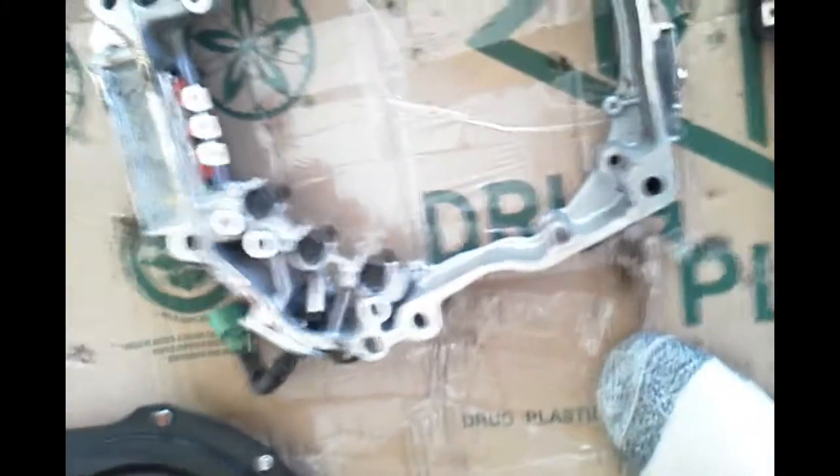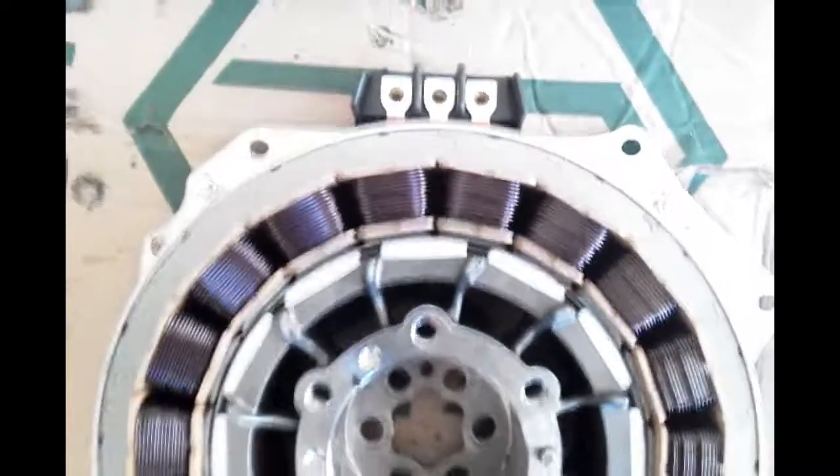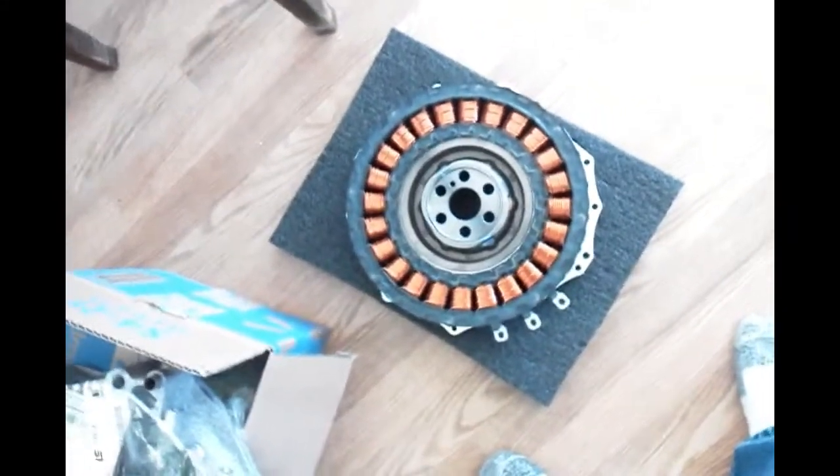They're kind of allocated in the right place. This is the Gen 1 Insight 10 kilowatt IMA motor with conventional windings. Now on the 12-years-later 3rd Gen Civic IMA — from 2013, though the design started in 2012 — you can see it's a square winding, which improves the fill factor. You have less dead space between the round surfaces compared to a conventional winding.